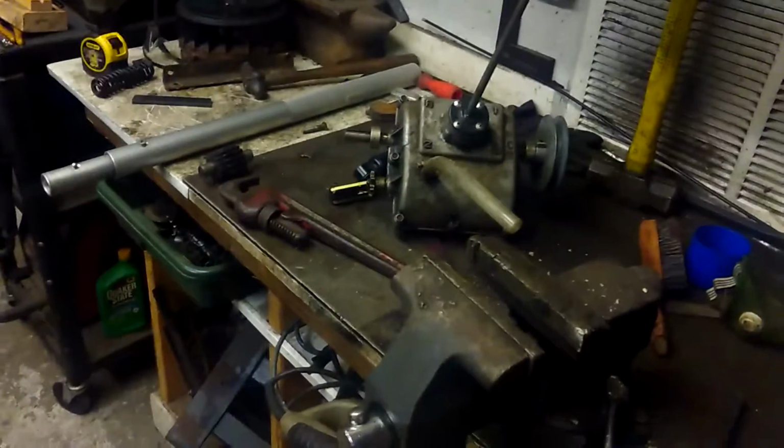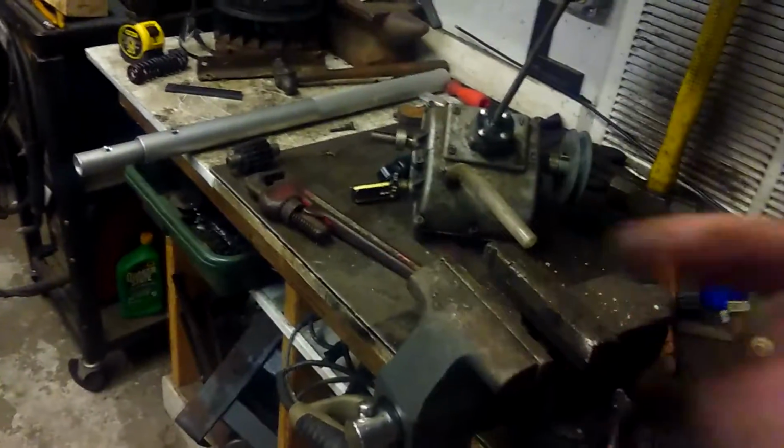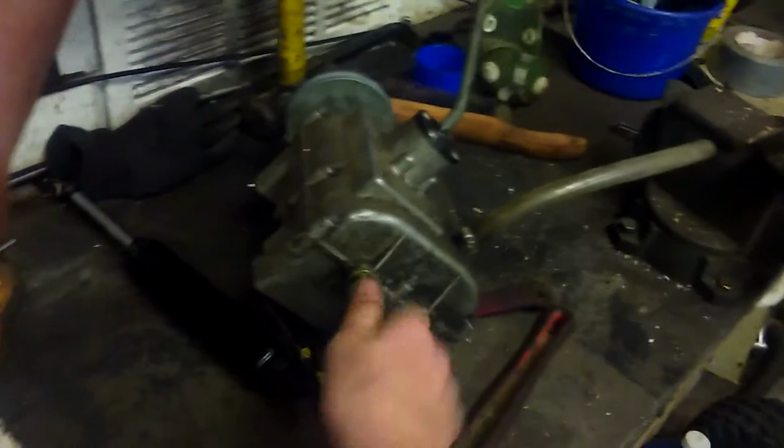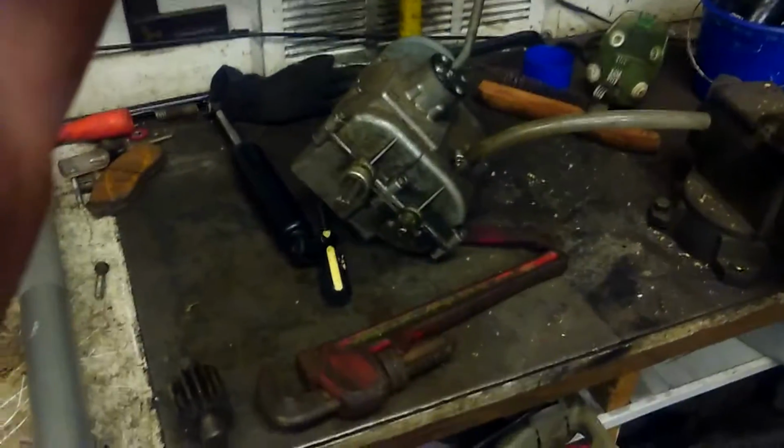Everybody says just throw out these trannies when they're talking about racing mowers, but when we're talking about go-karts or something, I wish that you could do this with a Peerless 700 as easily, because you need to have a spline shaft, because those gears have spline, or you can machine them with a key on the inside or whatever. But on this, it's all keyed and it handles the power, man. I got just regular 3/16 hardened keys from a lawnmower transaxle as the shift keys, and the collars slide on, and they work. It just hooks up and goes. I've never had a problem.